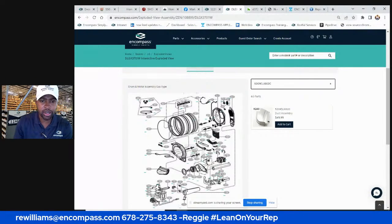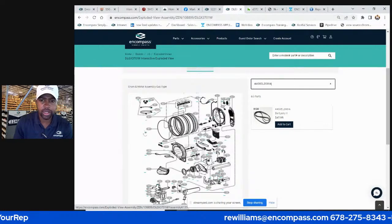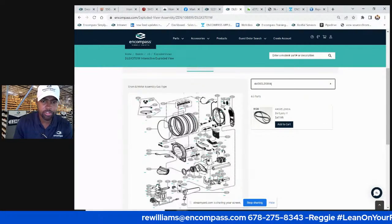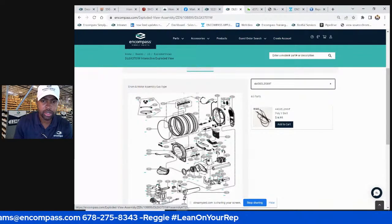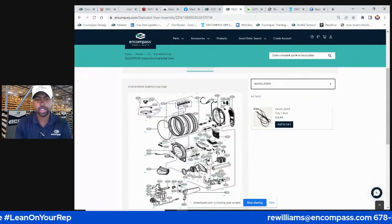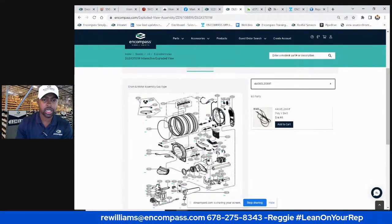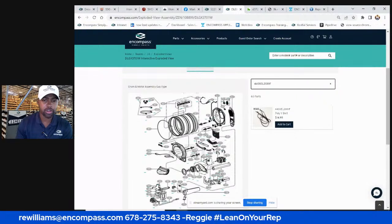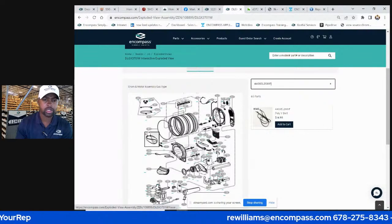So you got that. We got the element. Sometimes the felt here will go bad. That's a belt. Sometimes the felt on a dryer drum, some of them have felt, depends on the design. Sometimes it's on the bulkhead. But especially on any dryer, if you see a lot of coins, socks, and clothes down there, then either the felt is bad or those rollers could be worn. You need to replace the rollers, right? So replace some rollers and just some general maintenance, that belt replaced.